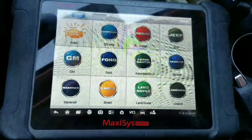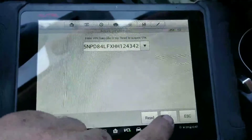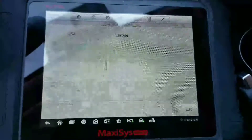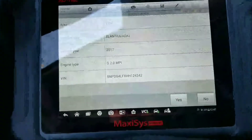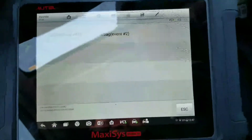We're going to get into the old airbag control module — the old one that's locked and needs to be replaced. Go to airbag event one, then go to ECU information. Once you get into the ECU information, you're going to see the variant coding — ECU coding code F201 on this particular car. Write down that number and save it; that's what we're going to use when we put the new module in to code it.